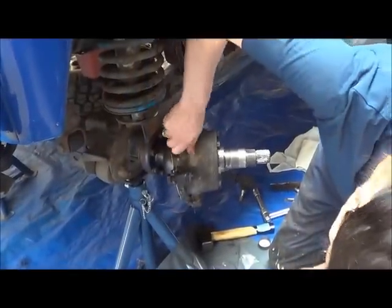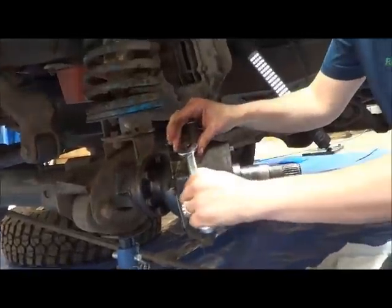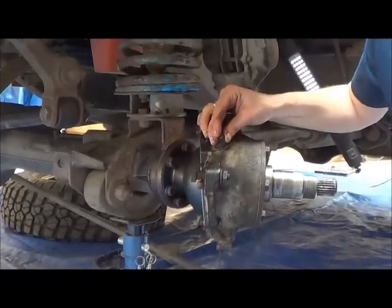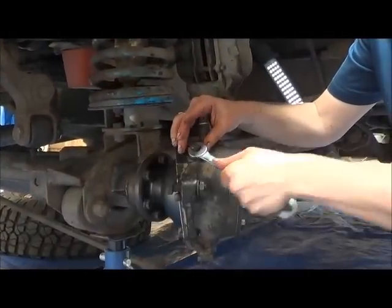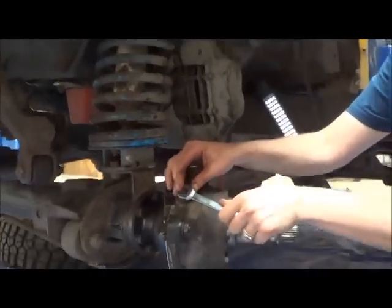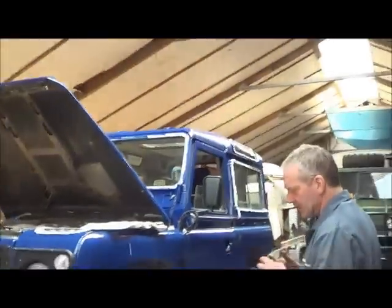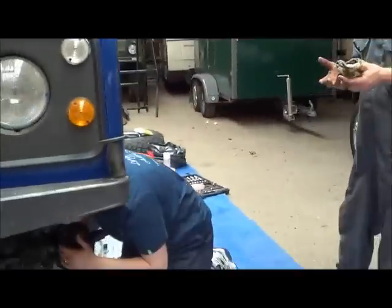So no. Every time that you do a service, what you should do is take that off, get a tie wrap, put a tie wrap into the hole in that direction, and the level should be about halfway on the tie wrap. So basically what you're looking for is that half of that swivel housing and ball are full of grease. That's what you should do. One sachet does a whole swivel housing from start to finish.